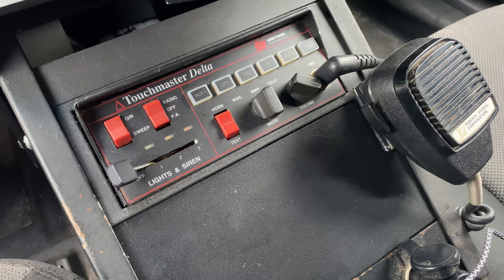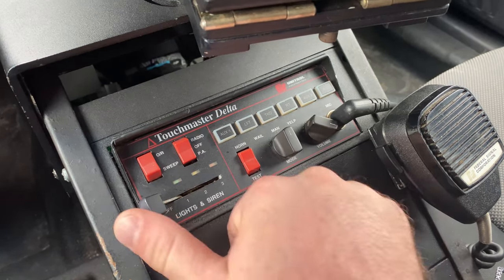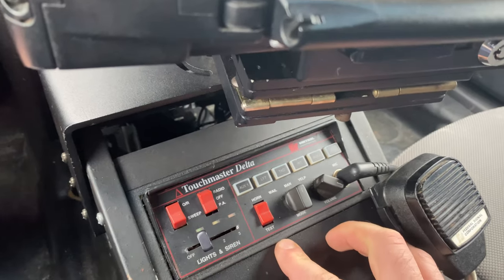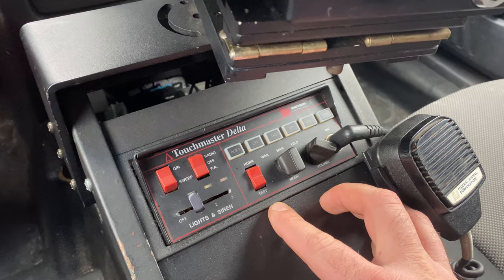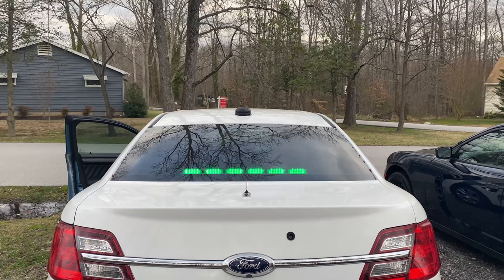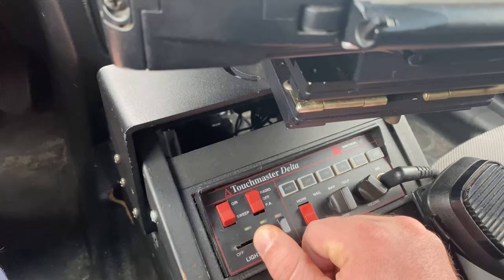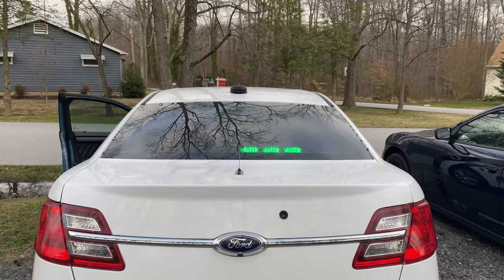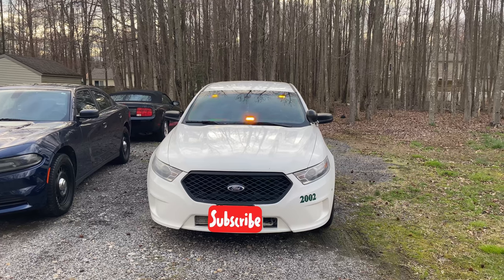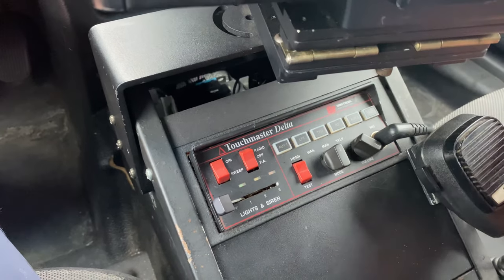Down from there is a siren and light controller. Our cars don't have the siren activated, but we use this for the light controller function. You control the lights mainly with this slide switch — it has three settings: one, two, and three. Slide one unlocks the traffic advisor function of the rear warning light bar, and I can hit these different buttons for left, right, and center. Slide two makes the rear warning light bar flash, and slide three adds in the front warning flash. All the way left is off. All the other siren controls are inactive — they don't do anything.